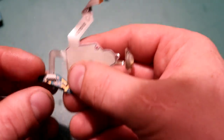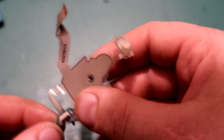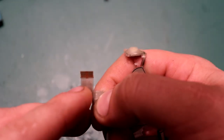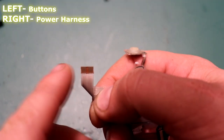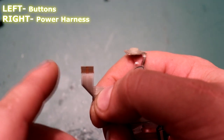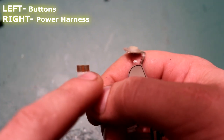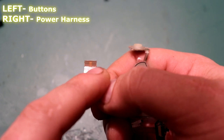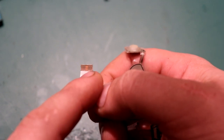So I'll put the power switch back on here. For a bit of education I'm going to show you how this works. We'll hot air rework this off and I'll show you the actual pin configuration. If you have a look closer here, you can see these pins running off here. They actually divide into two sections between this metal strip which is ground. Everything left of that is your X, triangle, square, circle and your R button, and then everything to the right of that is to do with the power circuit, LEDs, standby, reset, etc., and then the hard turn off. We're only actually going to use one wire though, and that's the one just to power the device on by pulling it to ground.